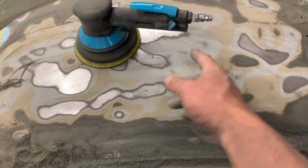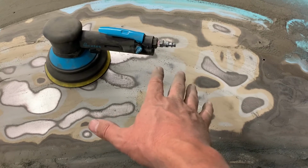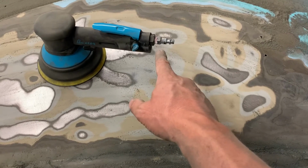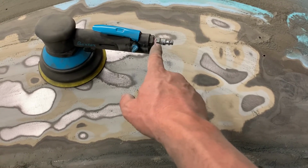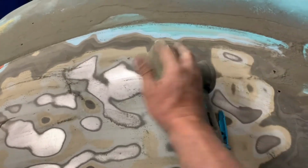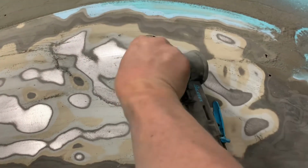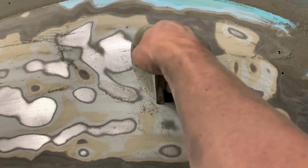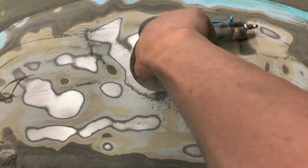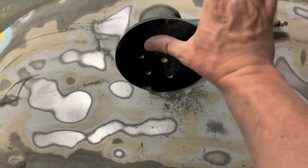And the other thing is, make sure you run a dryer. I was using the sandblaster and I got a little bit of moisture in my line, the sandblaster wouldn't work. So I put 2 dryers on over by the air compressor and I used a regulator. Just dial in the regulator, make sure it doesn't exceed 30 PSI. And then it's just the sticky, it's not the hook and loop. It's just the glue-on pads. And a roll of these discs from Harbor Freight is like $20 a 100. So it's pretty affordable, especially when this thing cuts like it does. See that? It's just sticky. And that's just another vinyl pad to stick to.